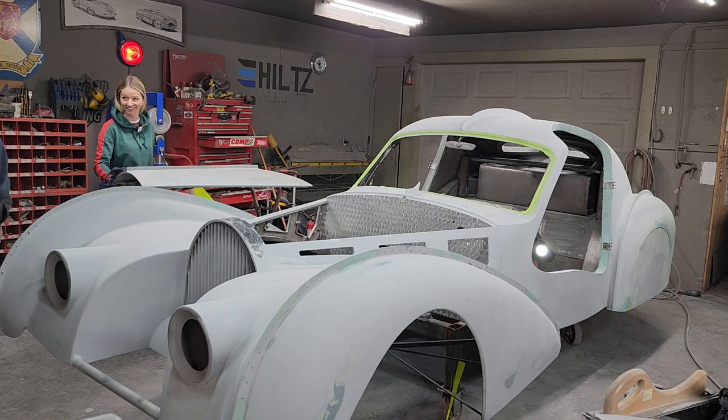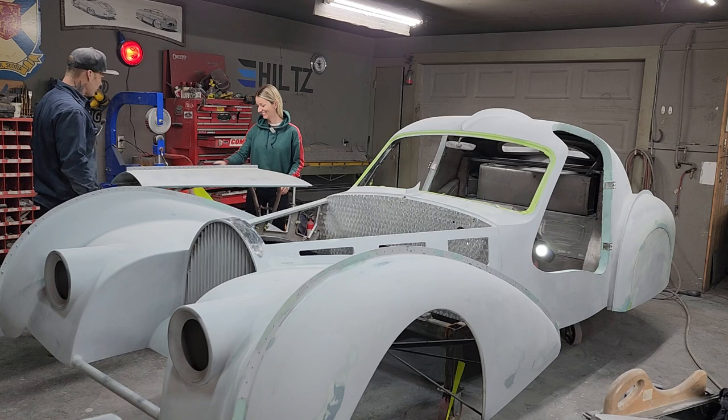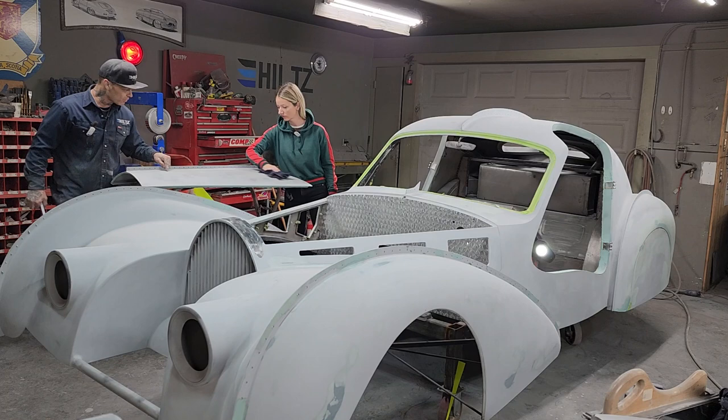Alrighty, welcome back. I'm your man, Bad Chad, and Queen Jolene's on the camera today. You're on camera. Queen Jolene's going to help me block the hood. On this side, it's already been blocked out. We can tell it's been blocked out because there's no guide coat on it. On this side, it's got guide coat on it, and she's going to go for it.